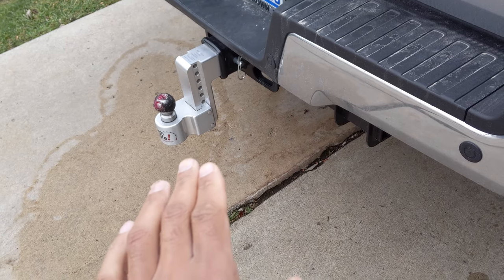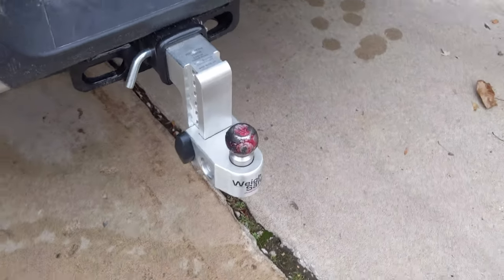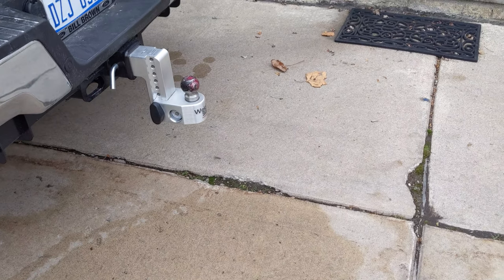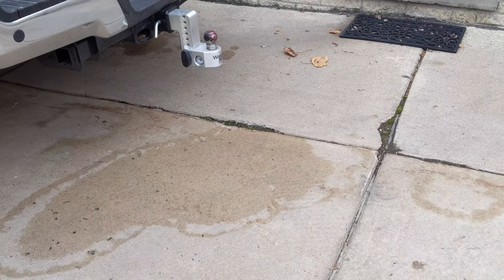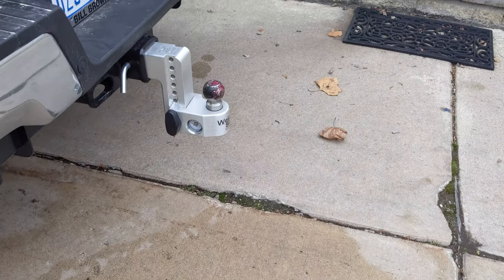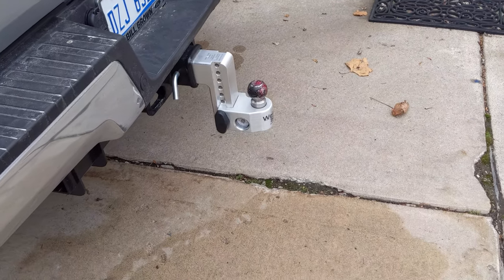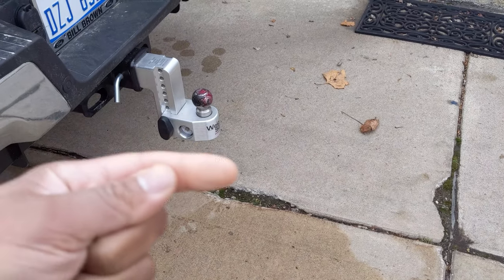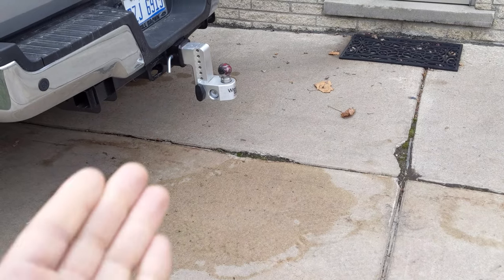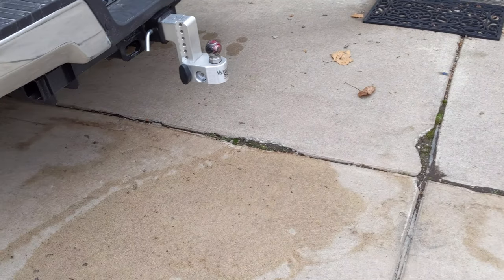With the old hitch, as you saw earlier, it was really loose. For that application it's probably just a good idea to use something like this to check your distribution, and once you know how the trailer is distributed, just switch to a normal hitch because it doesn't have all the moving parts and wear points. That said, I did order this new one. They do have a 180 hitch that has less moving parts — the one with the ball coming out the top — but upon further investigation that hitch still has the locking pin and could suffer from the same issues. They also have a straight 2-inch receiver hitch with a scale that doesn't have a drop, and that looks like it might be free from these issues.